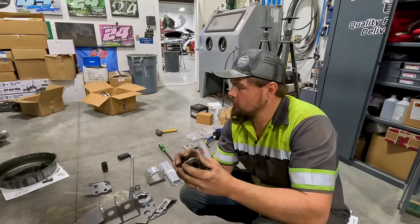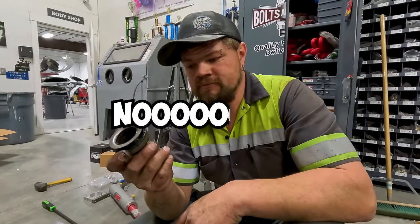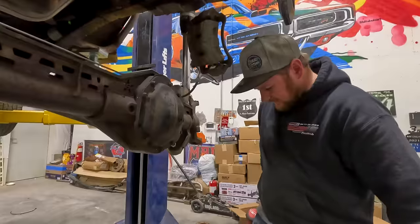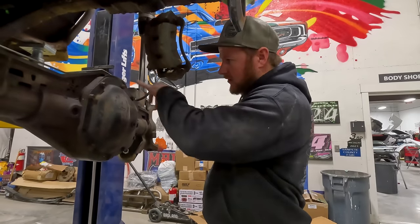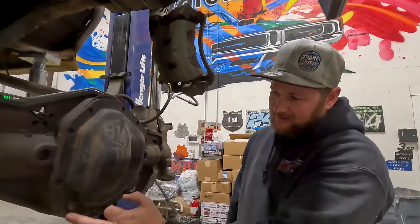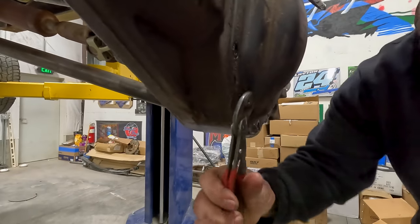I'm going to have to do what I didn't want to do — pull the front diff cover off. This right here in my hand is the inner seal. I can't even believe it! The way you install it is on the inside of the diff — the differential. So I have to pull the diff cover off. I'll pull all the bolts out and get this cover off. They're going to do a little inspection to see what everything looks like in there. I'm on my last bolt — this one looks like it took a hit from a rock — so I'm just going to undo it with a channel lock, and we'll be replacing it when we put it back together.